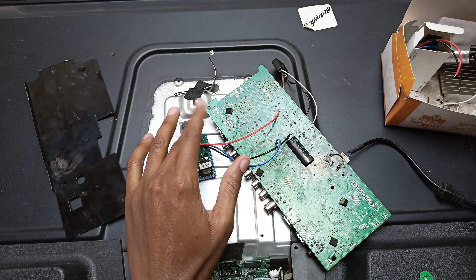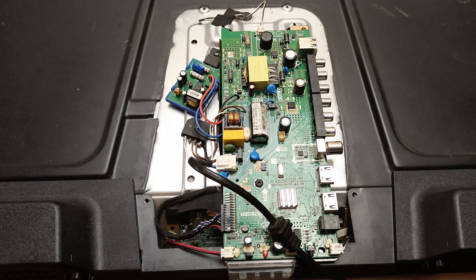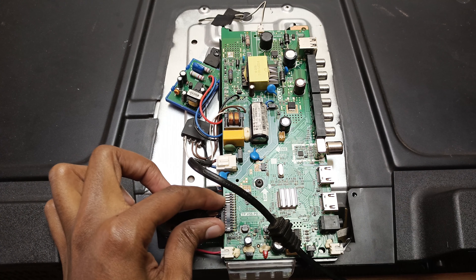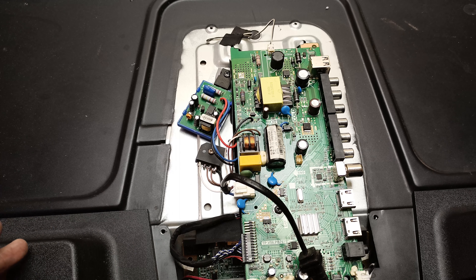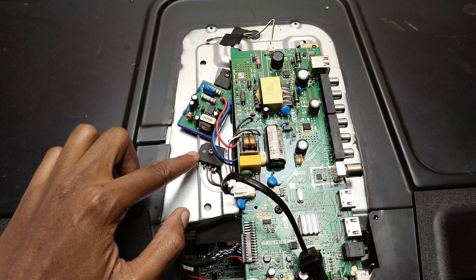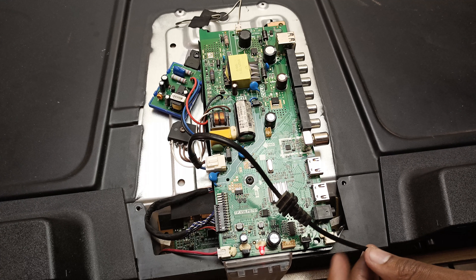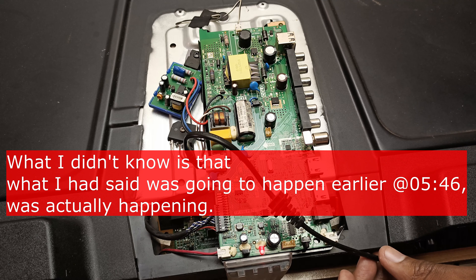I'm back at the TV. This is the shield used between the chassis and the TV board. In the first video we saw that switch mode power supplies have a hot and cold side, or primary and secondary side. The negative side of the primary or hot side is very different from the negative or ground on the cold side — there's no connection between them. The only thing that jumps across is the optocoupler.